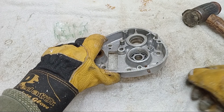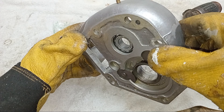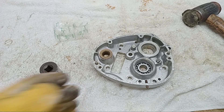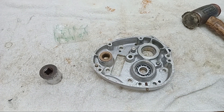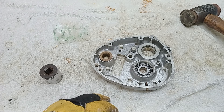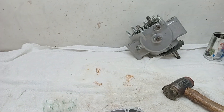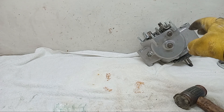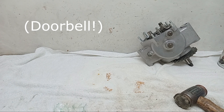In this case, that's as it should be for a bearing. If you remember the trouble we had with the inner case over there, you can see the difference — it basically fell in. We got the case nice and hot, the bearing nice and cold: shrink one, expand the other, and then it goes. I think these cases are probably machined too tight, too small, and that's why those bearings are really hard to get in — the main shaft and the layshaft bearing on the inner shell.